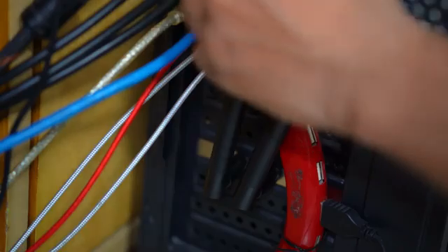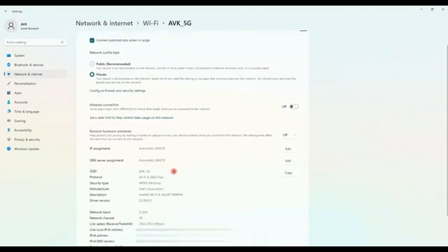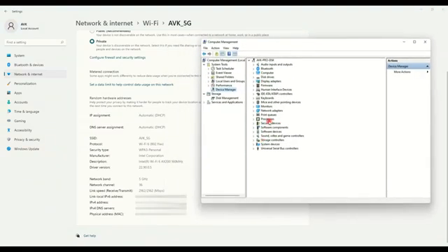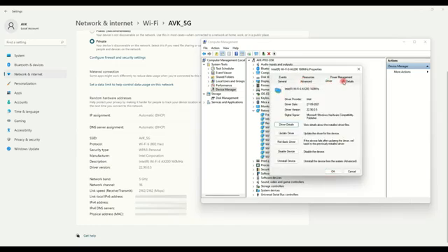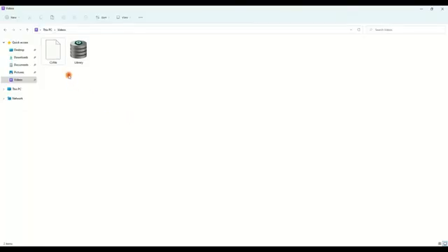We are done with the installation. Let's get into the desktop and check the performance. We do not need to install drivers if the system is Windows 10 or Windows 11. For Windows 8 or 7 we might need to install some drivers. I will put links for the drivers in the description of this video in case you need one. The card supports AX protocol and the fastest it can go is up to 2400 Mbps on WiFi 6, 5 GHz and 160 MHz channel. It also supports multi-user multi-input and output if your router supports it too.